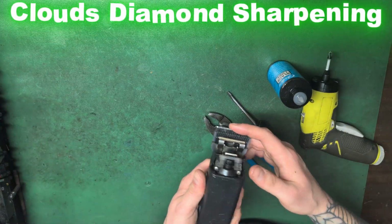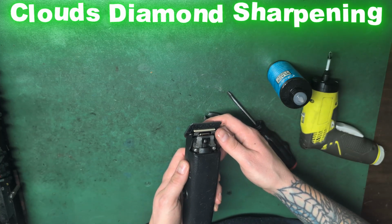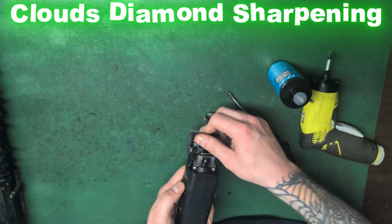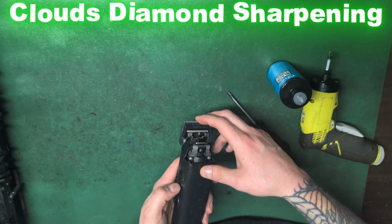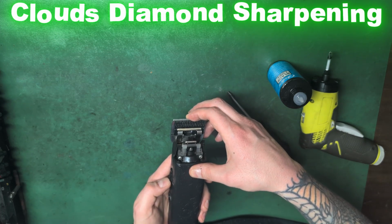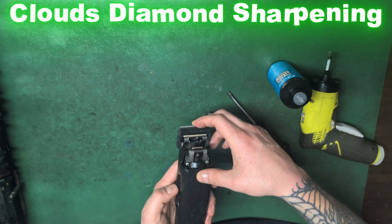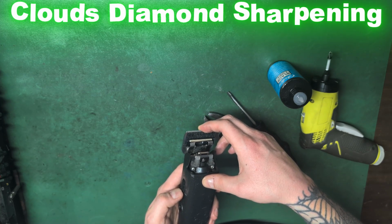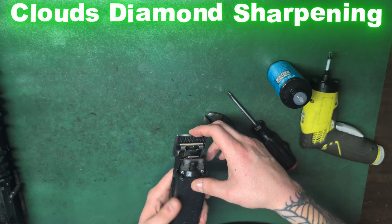Okay, so turn your clipper on and snap your blade on. It's better to snap a blade on while the clipper is running. It's better for the commutator, because otherwise it leaves little black marks on the commutator, and then your clipper may not start up and you have to get the commutator clean. You may need brushes faster. There'll be more carbon in your motor. It's always better to run.